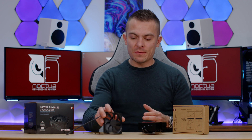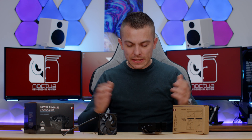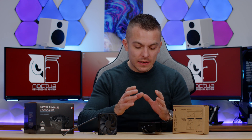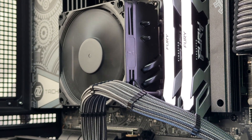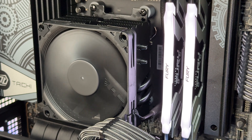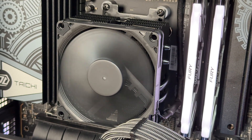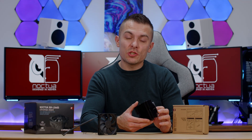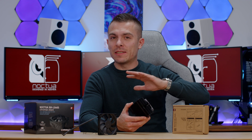This fan blows directly to the cooler and you need something to pull the air out — that's where the exhaust comes in. With the additional exhaust fan and the minus seven millimeter offset, you're only about 600–650 Cinebench points behind a 360mm radiator on a CPU with roughly 100W TDP. Thermal stability is quite good; clock speeds and benchmark scores don't vary too much across runs.